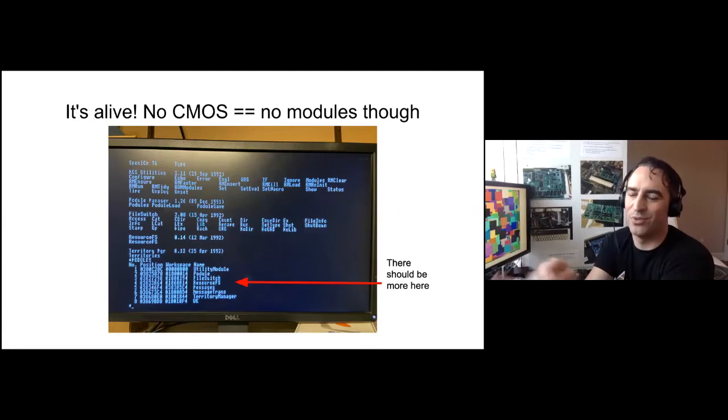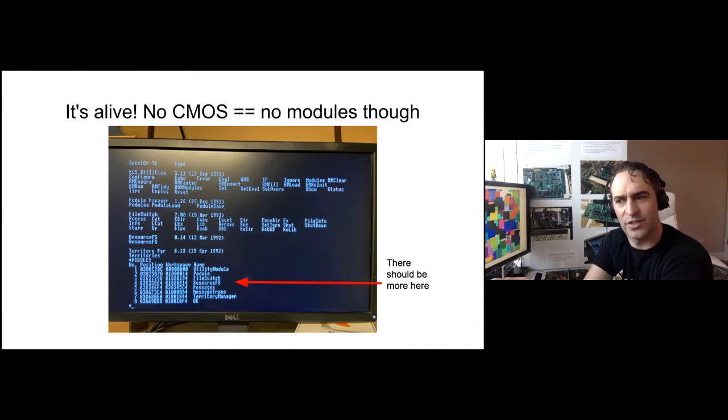What you see here is what happens if you boot an A5000 with no CMOS chip at all — it doesn't know what modules should be plugged in, so it's a lot of work to get to the desktop. Luckily I had the standalone board for testing PCF8583 chips, so we plugged that into the Econet and podule slots and it booted. But the POST still wasn't passing — showing an error and then an internal MEMC error. This wasn't good news because if that was really the case, I would have to replace my MEMC, which, as you've seen, is covered with wires.